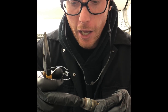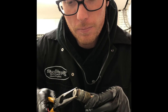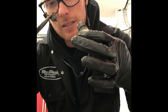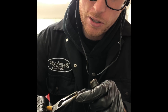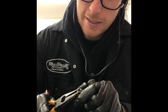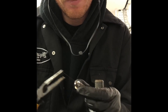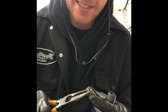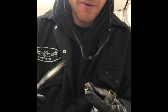This is the delivery valve that normally would just fall straight out of the delivery valve holder. It's covered in this horrible goo, and that is residue of your biodiesel — it's like horrible sticky treacle. I can't even pull the delivery valve out of its seat. It is literally so stuck in there.